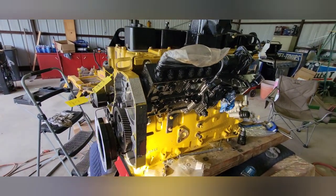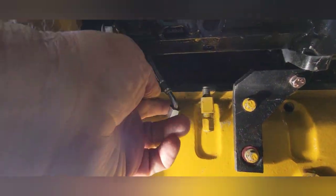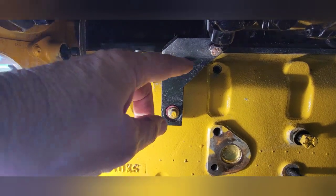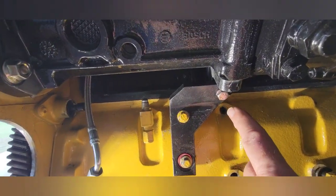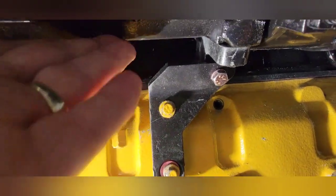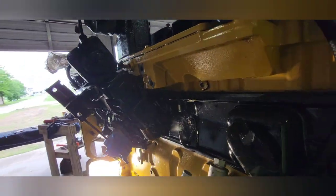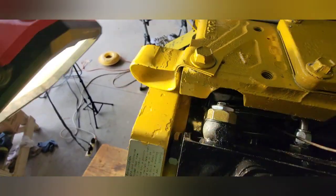Let's take a good look at what we've done since you last were with us. Mounting the P-pump just makes the engine come alive. You'll notice I haven't connected the oil yet — I have a new steel braided line I'm going to put on there. All these fittings have been put on and all of them have had thread lock applied so they don't come loose. One of the things that happened when we received this engine is that one of these fittings had broken off and fallen into the crate, so the whole P-pump was without support, and that can break the whole housing.